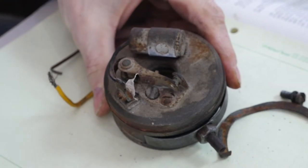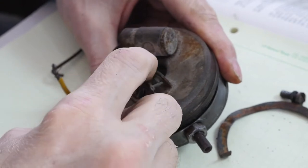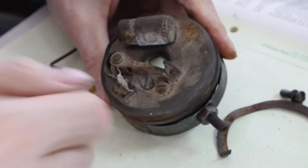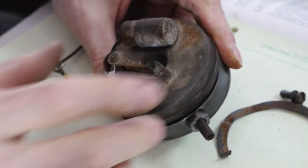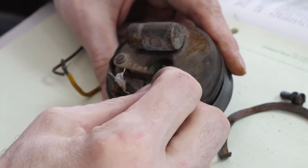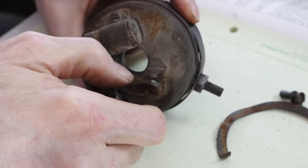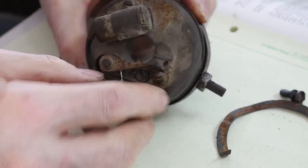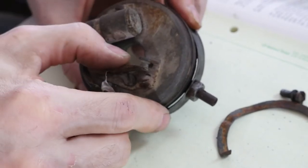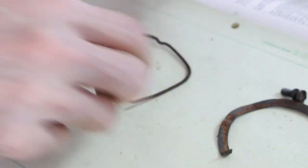I know the later model cone motors use the same as the six cylinder Chevy points. These might be different but look similar. There's an adjustment so you can turn it and adjust the dwell — you loosen this and adjust it. People think points are bad. See that silvery? These points are fine. They're grungy and rusty but that's another problem. If you lubed it all up and got this thing going, those points are still serviceable. The condensers are what tend to go bad because they're electrolytic capacitors and they leak.